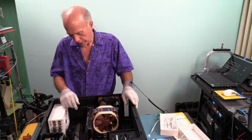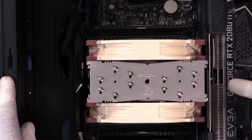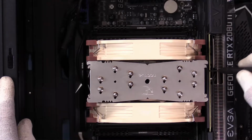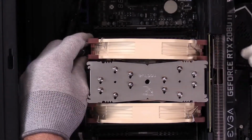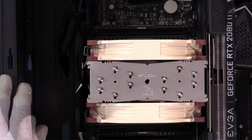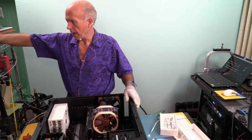And what we've got to do is we've got to raise these fans. The problem is with the fans, and if you'll notice, because we're so close here, I can't get to the clip right down here that I need to raise those. So we're going to see how well this is going to work. I can pull the clip on the left, but I'm not sure if I can pull the clip on the right. No, I cannot. Video card is going to come out. Okay.